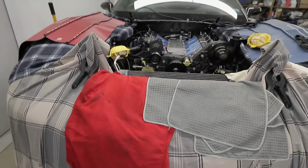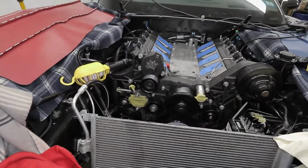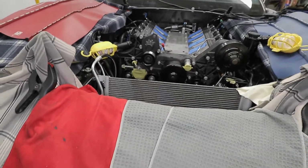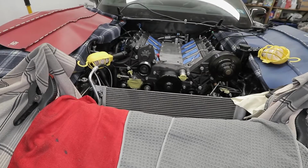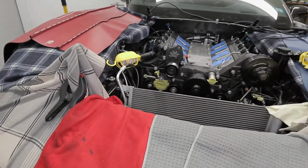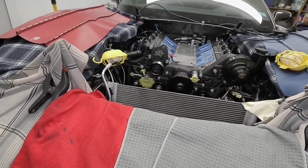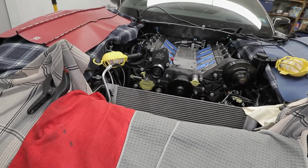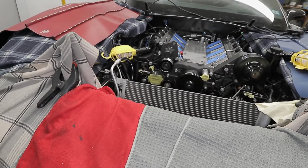A lot of people have different configurations. They use the EMP pump, and I guess they have good results. But in my opinion, the EMP pump, especially when it's reprogrammed, is way too much pressure. It's like almost 40 psi of pressure with some restriction in the system. So heat exchanger and intercooler bricks, 30-40 psi is way too high of a pressure to be running in your intercooler cooling system. It's just crazy.